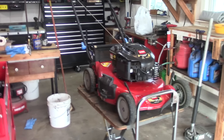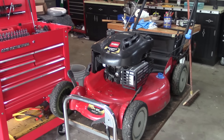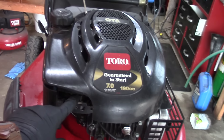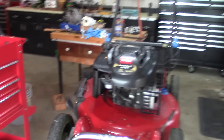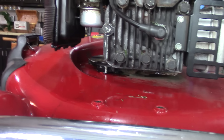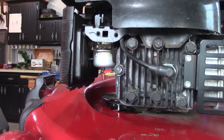Hey, what's up guys, Double Wide Six here. I have this Toro in here and I actually just fixed this thing about four or five weeks ago. The issue before was the guy was mowing under a tree and he banged up the throttle spring, and it was running really really fast. I adjusted that for him, gave it back, and now he just called and said there's fuel dripping out of the carburetor. You can see the fuel on the deck and if you look closely by the air filter you can see it dripping right off the corner — there's a drip being formed.